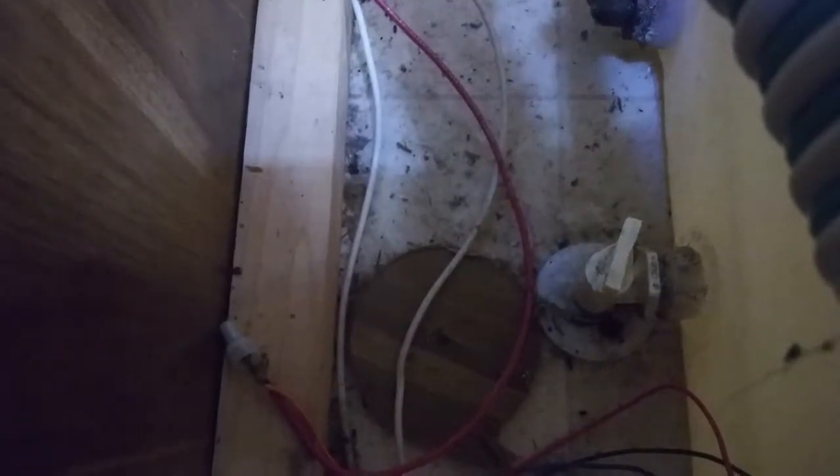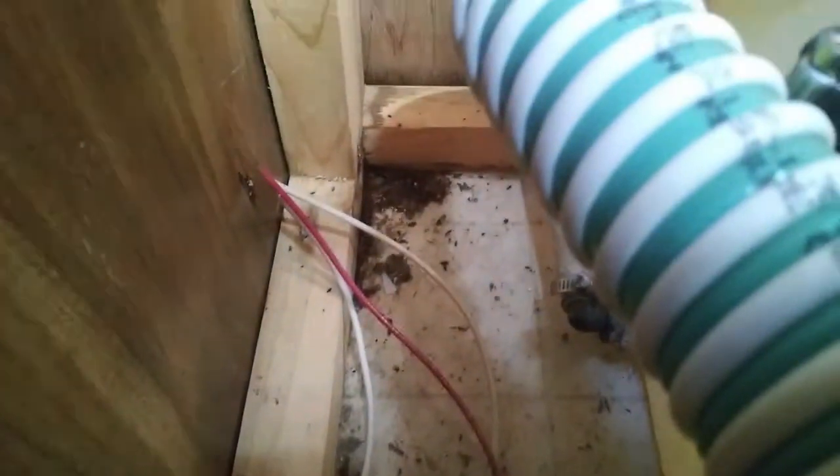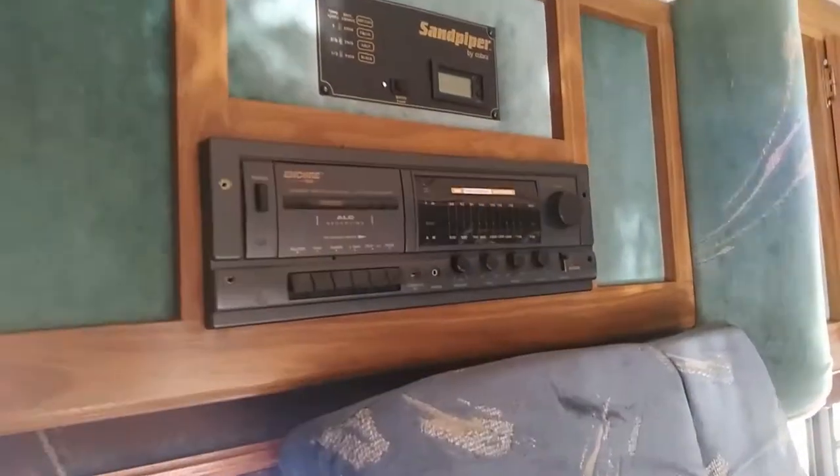In spite of my efforts, that thing is so old it feels like melted plastic. I'm not going to take a chance of twisting it, breaking it, and flooding this area — you can see all my wood here looks good, I don't have any rot. Since I'm already leaking on the other side of the trailer, I'm just gonna go ahead and turn on the water pump, run this through the gray water — the gray water tank's already empty anyway — and just open up the valve like you're dumping into your sewer tank, to get rid of this fresh water.